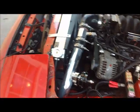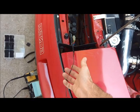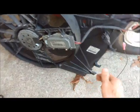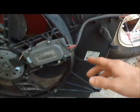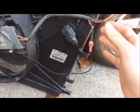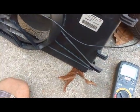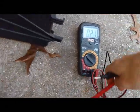So I wanted to fix that. Here's a little test I ran. Basically this is your fan on/off output that you would usually use on the MegaSquirt — it's actually labeled 'idle' in the software. I've got it running to this PWM controller here, with the little wire on the controller, and I've just got constant power and ground going into the controller. I'm not sure if I'm going to switch it on and off with a relay, but they said don't back-feed the MegaSquirt with it off.